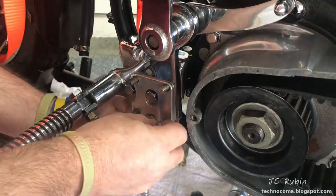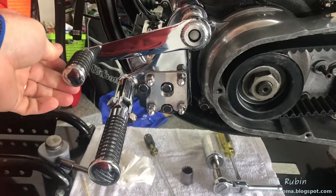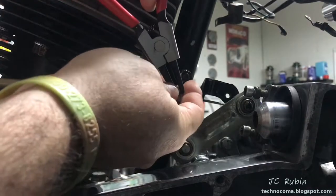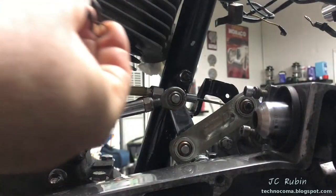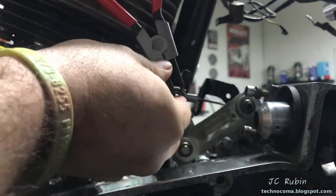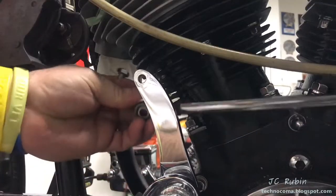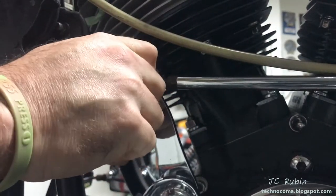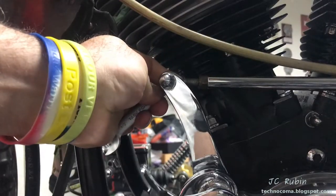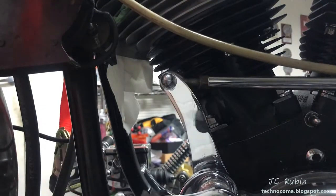When it comes time to tighten the clutch hub bolt, I'm going to want the transmission in certain gears, so I'm running all these bolts back in. One bolt is blocked because I have a kickstand adjusting wedge which I'll have to remove to tighten down the nut. Once these are tightened down, I'll loosely fit that wedge back on — the kickstand won't go back on until later as it'll only get in the way. Now I'll connect up the linkage; I left the circlip in here so I wouldn't lose it, and I'll remove it now, put the linkage through, put the clip back in, line it up, and run the bolt back through with a chrome acorn nut on the other side.